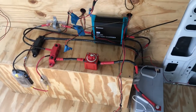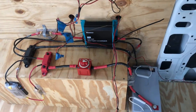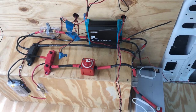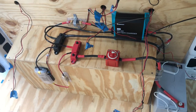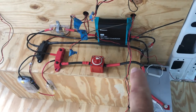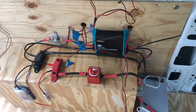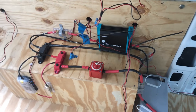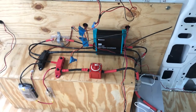One more thing. When doing this, you kind of wonder what type of fuses to use, what type of wire. Just remember, in my opinion, whatever wire you're using, gauge your fuse or your breaker to that. For example, coming into here, I've got number 6 gauge wire, and I think the maximum for copper wire on a short distance like that is around 50 amps. So I have a 50 amp breaker there. I know there's a 200 amp breaker here. I know coming in here that I'm only running a 20 amp charger here, so I put a 30 amp on both sides, but that's number 4 gauge wire. So I'm running my fuses or my breakers according to my wire size, not according to the items that I have on here. It helped me out doing that. I think that's, in my opinion, the safest way to do these things.